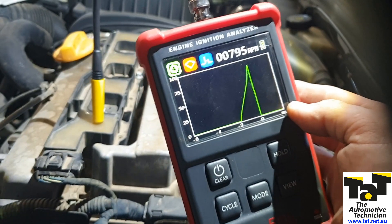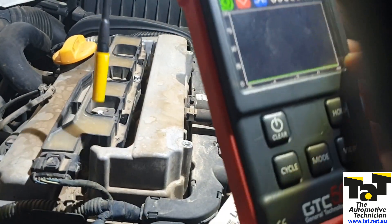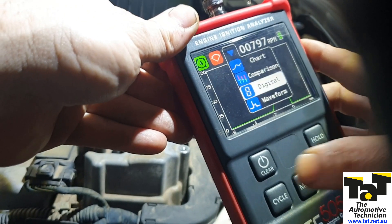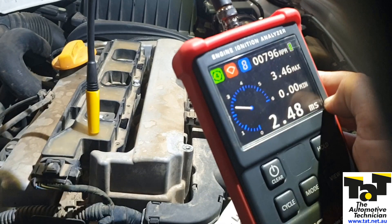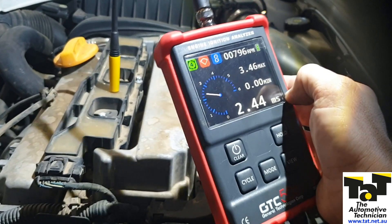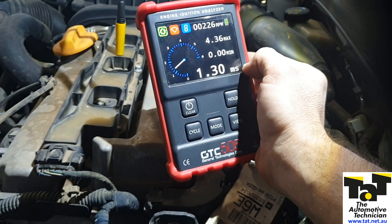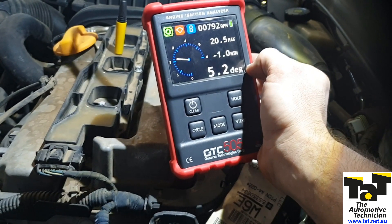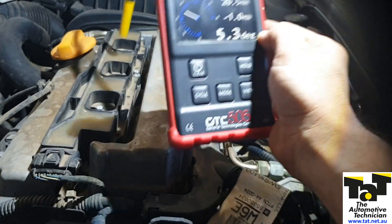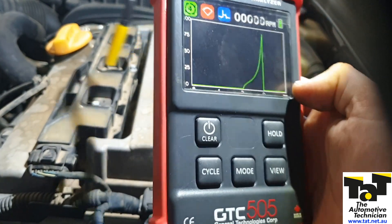A lot of that comes down to where you're getting it. Really, all I'm using this for at this point is to say yes, I definitely do have a trigger to all of these. By the fact that our amperage reading ends up at about a similar rate, if we go to digital on ramp time we can see we're getting a similar reading — about 2.5 milliseconds of ramp time across all cylinders, maybe slightly lower at 2.2 on one. I'd go get an amp clamp if I wanted actual diagnostics using the waveform, but we know we're getting a trigger, power and ground, with no massive difference between them.